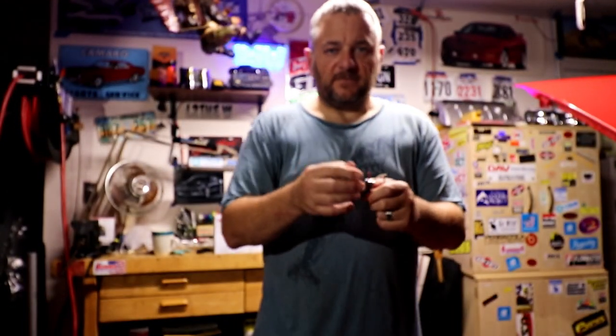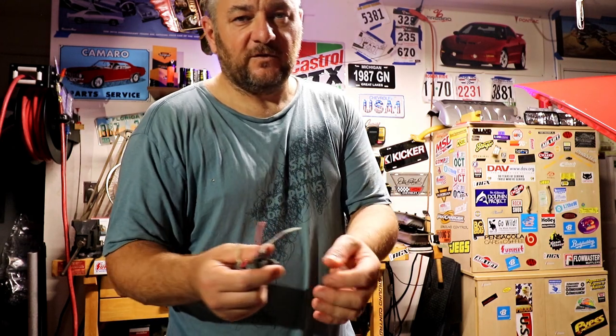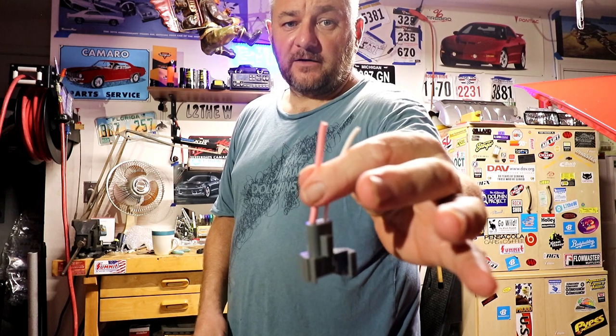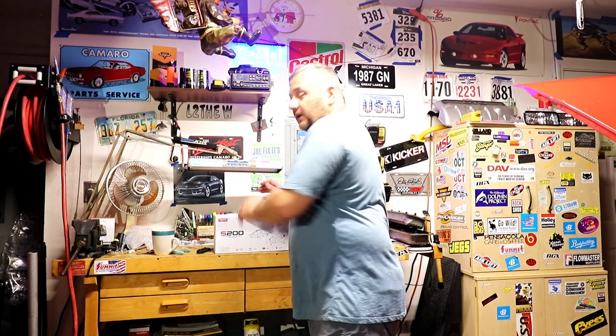There's only so many wires, and even though it's making a connection, if a lot of these wires are broken we could be losing voltage. So maybe instead of 14 volts it's only seeing 12, and the coil is not firing as well as it should. To be safe, I'm going to go ahead and get this done. I've got the soldering iron heating up — we're going to solder and heat shrink this, make sure it's weather tight and as good a connection as possible.